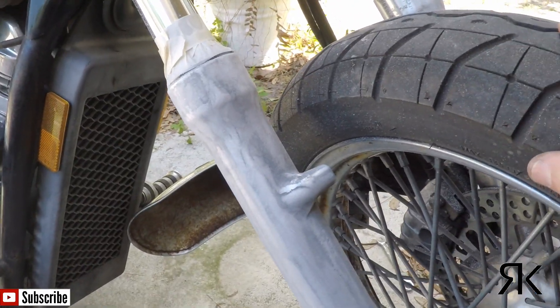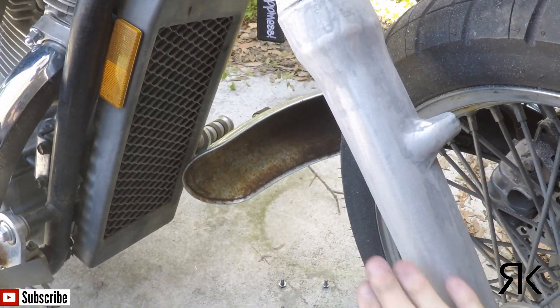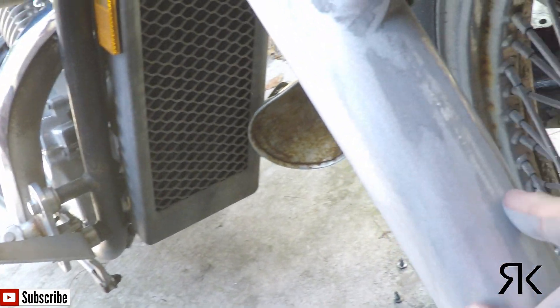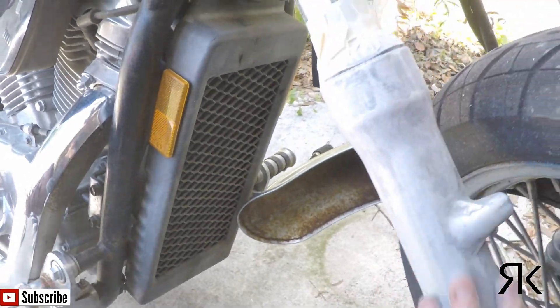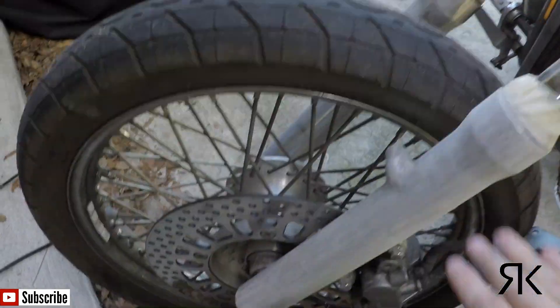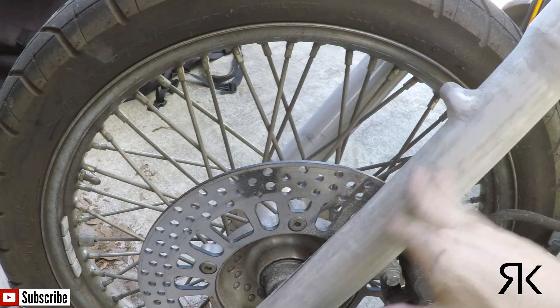Here's where we stand so far — just after going through 220, it's getting pretty smooth and cleaning up nicely. There are a couple spots I still need to work through, like right here where you can still see it's shiny. You don't want that; you want it all to be a pretty uniform look. If you see any shiny spots, make sure you go back over them with your sandpaper before you lay down the spray. Then I'm going to move to my 400 grit sandpaper, and as soon as I'm done with that I can start masking and lay down my satin black spray onto the fork tubes.